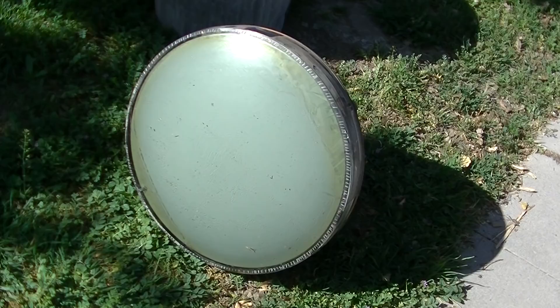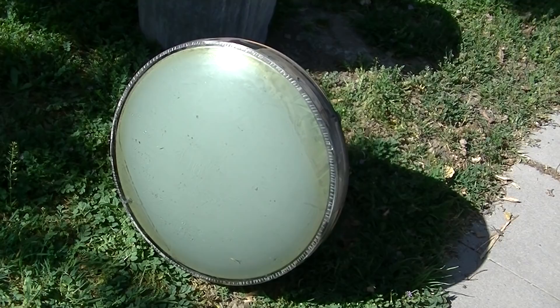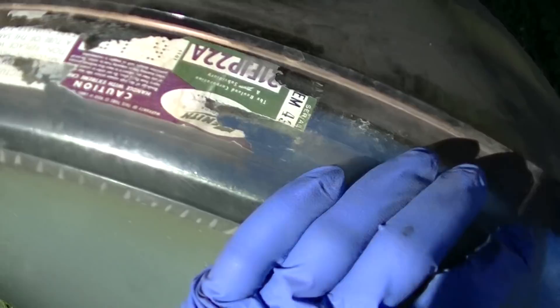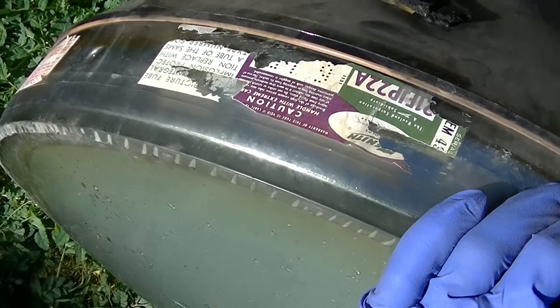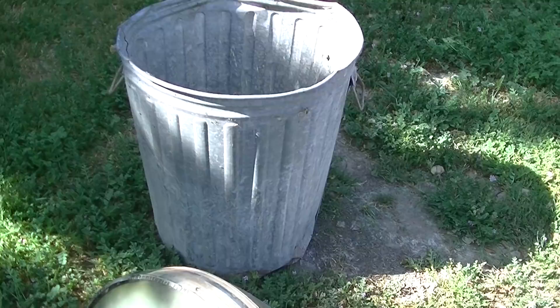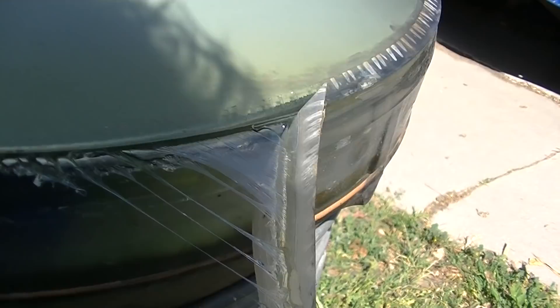These never seem to get horrible until the stuff starts turning to liquid and dripping down into the bottom of the cabinet, making a mess. The way you remove them is totally different — the RCA style you use heat and pressure, and this Zenith style you just use a wire, a guitar string, piano wire, just a piece of really tough wire and cut it off. It says Zenith right on it, 21FJP22A. First thing I'm going to do is get it upside down in this trash can and let it bake in the sun — it's pretty hot today. You just want to soften it up as soft as possible.